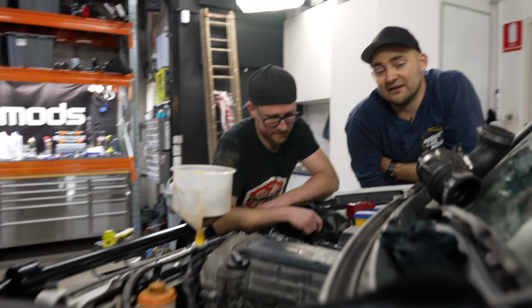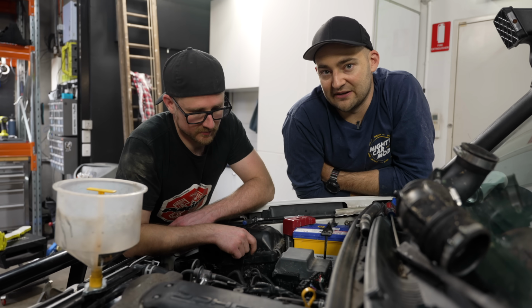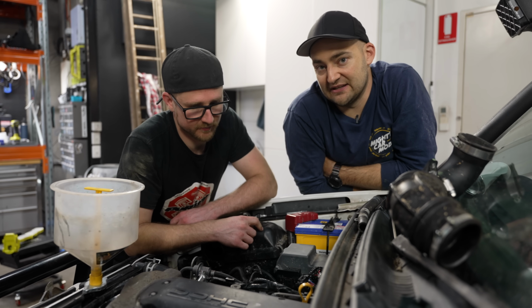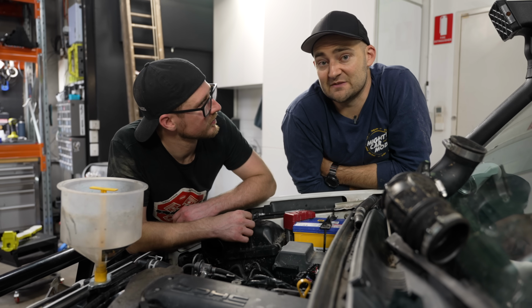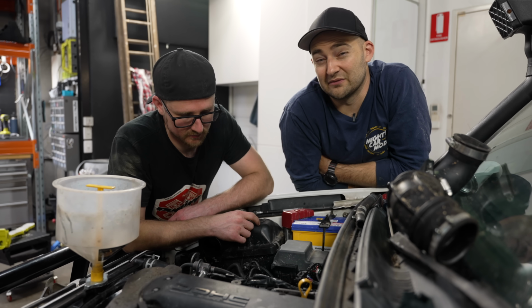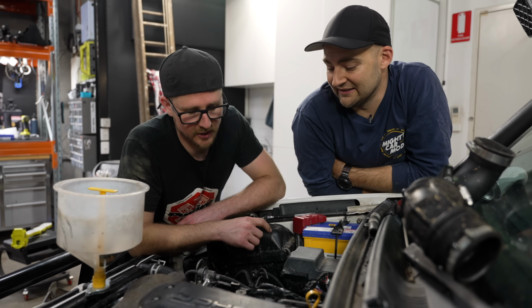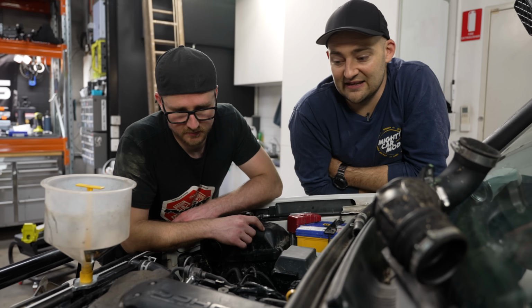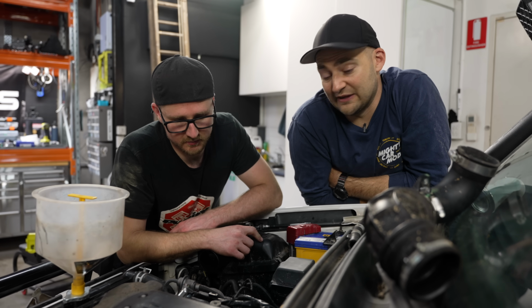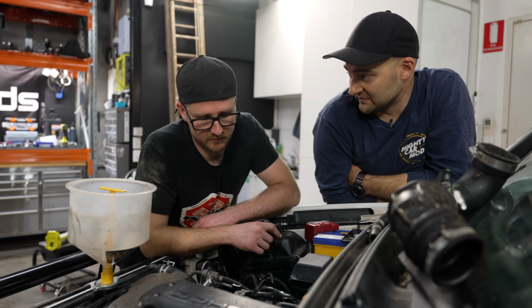Yes. That's my bet. The reason I think maybe catastrophically blown head gasket is, why was this car at a wrecker in the first place? Was it crashed? Yeah, okay, maybe. When it was crashed, did the radiator get smashed? Was the thing still running? The knock sensor looked like it had gotten really hot, which sometimes is because the thing has gotten so hot that it melts everything around it. Yeah. And that often cracks heads, blows head gaskets. And from the outside of the engine, you can't tell. So we just got stung by a crappy wrecker engine potentially. Yeah, absolutely.